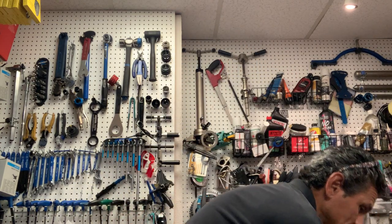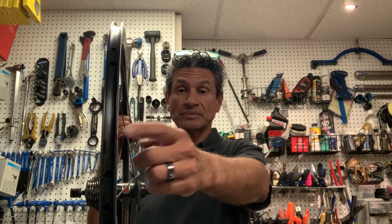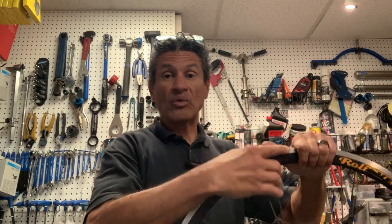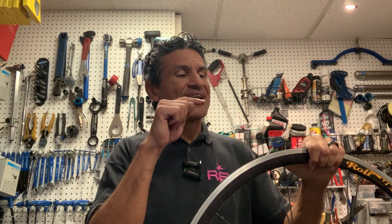The other reason I wanted to mention it is because I'm working on a lady's bike, and I honestly don't think she knew this tire was on there. I believe her husband used to do all the service on the bikes, so he put this tubular clincher on her bike and I'm sure she didn't know what it was. When she picks up the bike, I'll debrief her or maybe I'll send her this video. But there's no rim strip now — with a tubular clincher you don't use a rim strip. So when I removed this tire I was like, oh, this is what this is. And now I need to install some rim strip for her. That's all for today — please like and subscribe. We'll see you up the road.